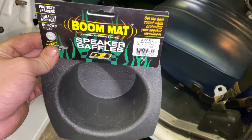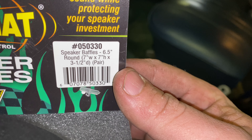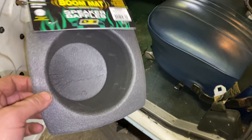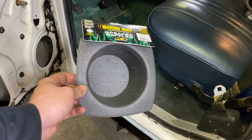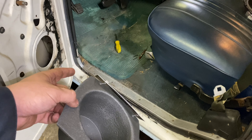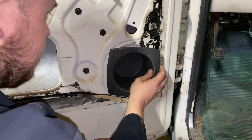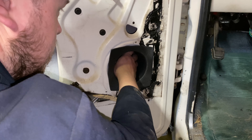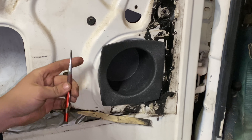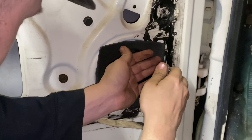Another thing we'll be adding is some of these — they're called a Boom Mat. I picked these up at AutoZone. There's the part number and all the information on it. All this is going to do is slide right in that hole, and this will protect the speaker — it'll make it waterproof, so if any water gets on it it won't get on the speaker. It insulates it and also improves sound quality because it'll force the sound out into the cab instead of being echoed out inside the hollow door. Once it's in, I'll take my automatic center punch and go from the back and poke the holes, then take my razor blade and trim around the perimeter to make it fit better.